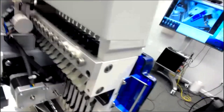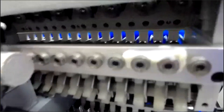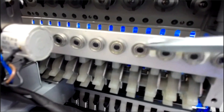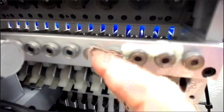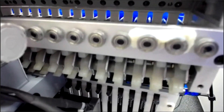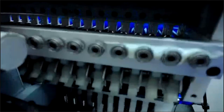Once a month also look at your rollers in the back and see if they're clean. If they look even slightly dirty, take the oil pin and put a drop right in the middle of the little black dot in the center of the roller, then take your fingers and roll across the rollers. You can also use WD-40 — spray it behind these rollers to keep the inside lubricated and clean out dust, lint, and excess dirt. Keep a paper towel down here because it will drip. Then once you're done, just take your finger and roll it across the rollers to get it nice and smooth.